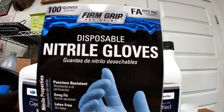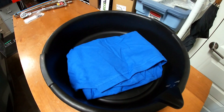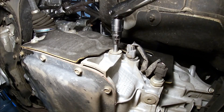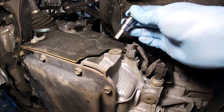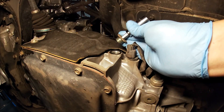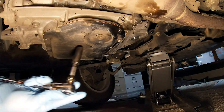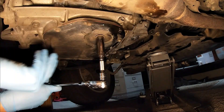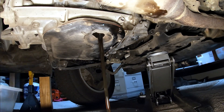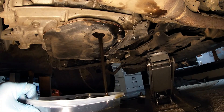You don't have to remove this plastic cover but it will make it a lot easier to get to your fill port on the left side of the transmission. Grab some good nitrile gloves and a drain pan and we'll drain the oil out. You're going to need an 8 millimeter Allen socket for the fill plug and a 14 millimeter socket for the drain plug. I started with the fill plug — it takes a little bit of effort to break these free. Don't forget the gasket; mine got stuck on the transmission. Then wipe the area clean. Loosen up the drain plug and remove it, and be prepared to take a sample of the oil while it's draining if you're into that. Make sure your drain pan is large enough.